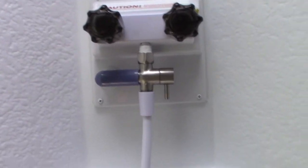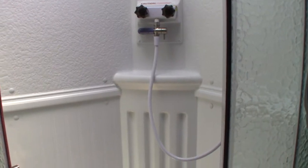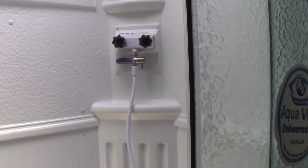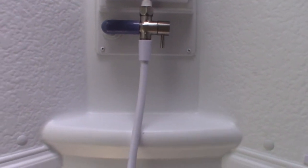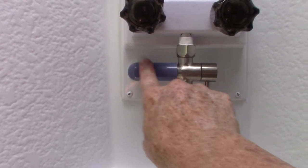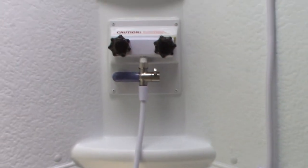What makes this different is the shower miser right here. The shower miser is a water circulating system: while the water is heating up, instead of going down the drain it loops back around through the water heater and pump in a continuous loop. This device will start to change color, and when it turns beige it means you've reached temperature — then you can shower and it'll come out hot without having wasted any water or used up gray tank space. That's a great green feature.